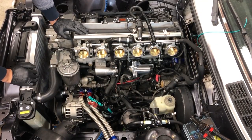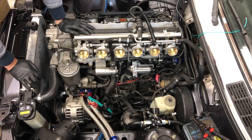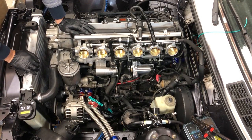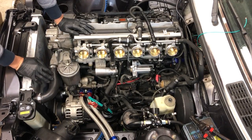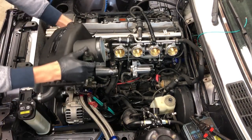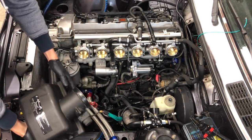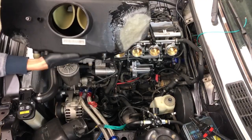So now we're going to go inside the vehicle and go over the codes. The main problem we have is that there are no lights, so we don't know if there's a check engine light whenever we clear it. But every time we clear it, the check engine light always comes back on automatically because of this sensor. It was circuit D and circuit E for the TPS that we had issues with. Here we have the MAF sensor — the reason why it wasn't starting earlier was because this was plugged in. This is supposed to measure the amount of air going into the engine. The intake manifold from previous videos — we can see now it fits.